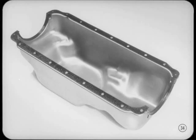There are some new gaskets on the market that retain elasticity during use, but the price of a new gasket is a pretty small insurance premium against a comeback, so don't use the old gasket.